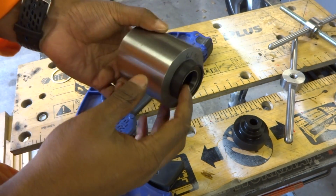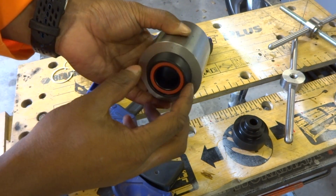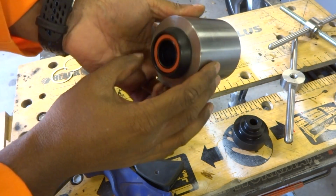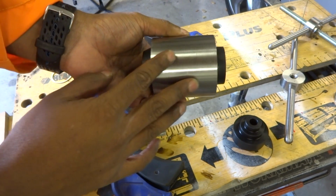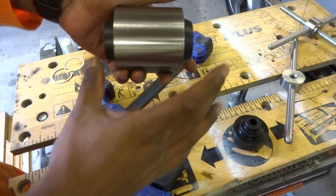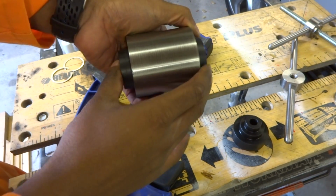So now we have very, very good alignment between the two bearings. There's only about 5 to 10 microns of misalignment, and that's because the alignment is carried by the bearing sleeve and not the machining process in the bike frame. Admittedly, this bottom bracket shell which I've made, or a dummy, is well machined in terms of tolerances, but with this type of bottom bracket, the one piece, you've got very, very good bearing alignment. The space between the two bearings is absolutely as Shimano intended. So it's probably as good as you'll get.